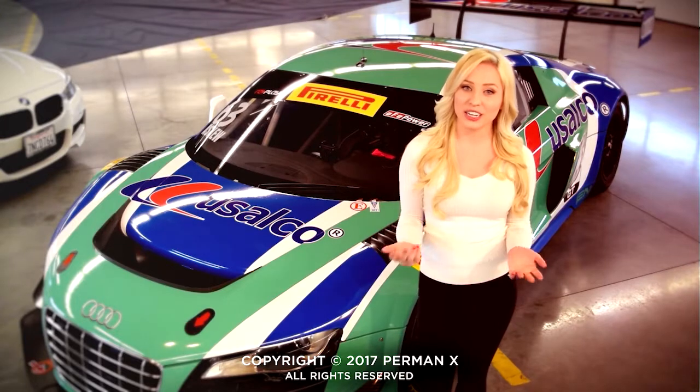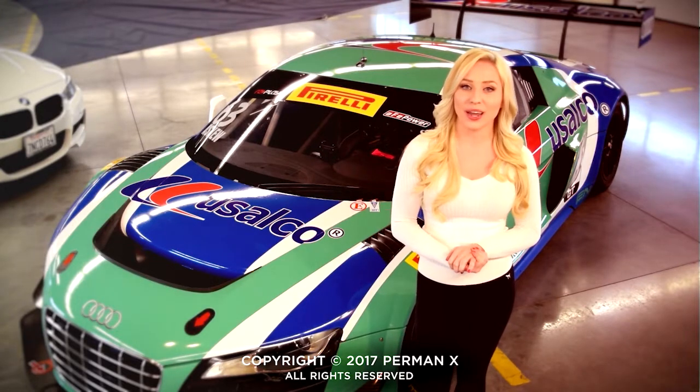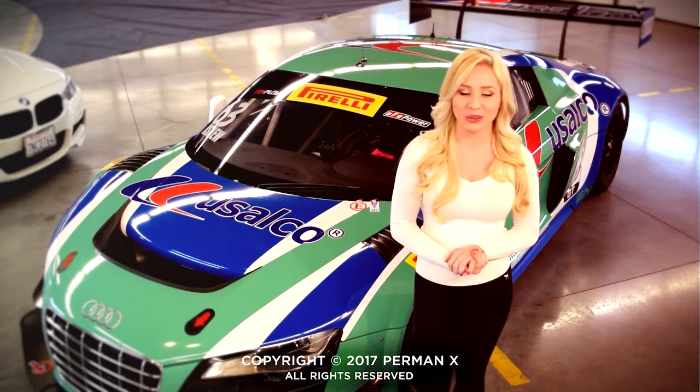We recommend that you apply at least three coats of Diamond Shield to your vehicle, waiting at least four hours between each coat to achieve the best results. Try not to get your car wet for at least 24 hours, and wait at least seven days before washing your car. Enjoy your shiny new ride!